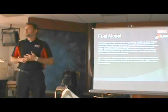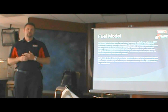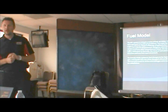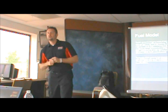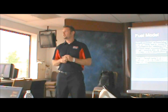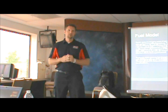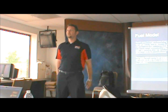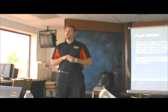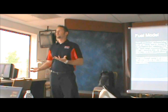This is a bit of a complex subject, but I want to touch on it because there are some really cool benefits to it. Anybody that's used a lot of aftermarket ECUs, but also our M800s, our previous stuff, you have an injection pulse width table that doesn't really mean much. It's just how much fuel you want to deliver. It has nothing to do with the characteristics of the engine. So when you make a change, you put new injectors in, you have to retune it for those new injectors.